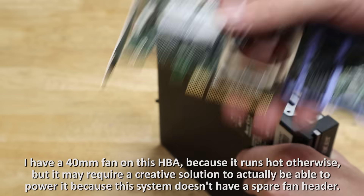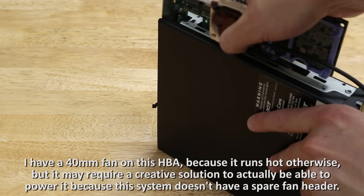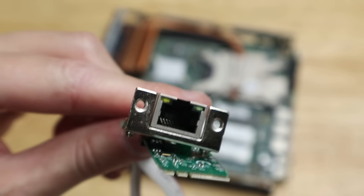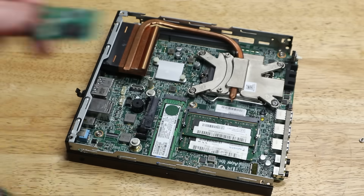Being a mini PC, you're quite limited for storage, but the PCIe slot can be used for things other than networking and graphics, such as a SAS HBA. This could potentially be used for some of the custom DAS enclosures seen on various forums, and would serve as an excellent replacement for the M.2 M-key SATA cards that some people use, which have significant reliability issues. It's a more reliable solution to connecting storage to a mini PC, even though the system itself doesn't provide any space for that storage internally.